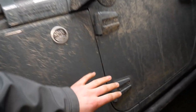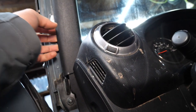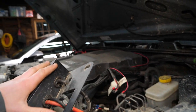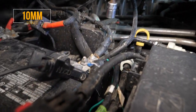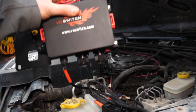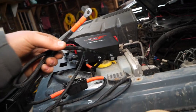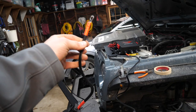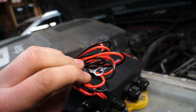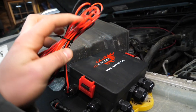The wire should pop out somewhere around the footwell, at which point we'll pop off a couple pieces of side trim and also remove the A-pillar trim. But before we get there, let's just worry about getting power hooked up to our new box. Grabbing our 10-millimeter socket again, we'll go over to the battery and break loose this 10-millimeter. Incoming: second generation Voswitch JK100. We only have one main 8-gauge power lead and this tiny little ground to hook up.